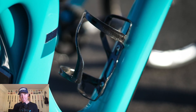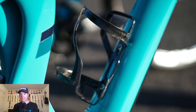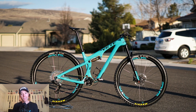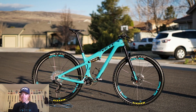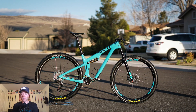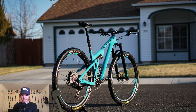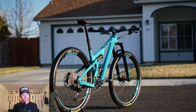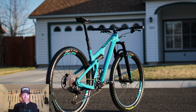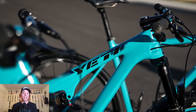There's the Specialized ZCage, the carbon version — I don't run a tool on this one, just to save weight. I like being able to pull from the left to keep my throttle hand on the bar, since I'm used to moto. On the shock, I run all the way up to 172 PSI, which is a higher spring rate than normal, but that's what I love. This bike is super underrated by XC racers. It descends better than basically all their bikes, and the thing climbs so incredibly well on both smooth and rough climbs — it's an incredibly fast XC bike and a great trail bike.